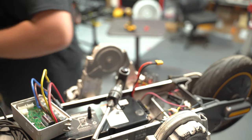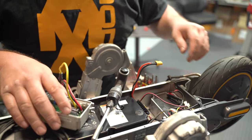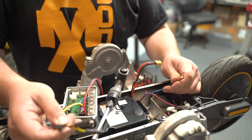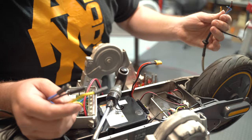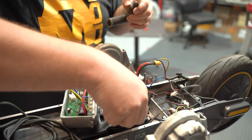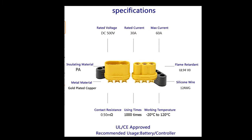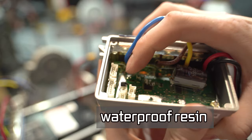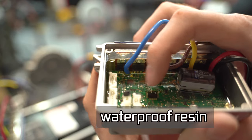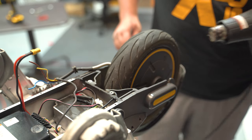This controller is done. We have a new controller here with new phase wires, and no phase wires on the motor, so we're going to upgrade these to MR60 connectors. My post-production conclusion is: if you're 200-plus pounds, have lots of hills, and are riding with a 48-volt external kit, it's probably worth upgrading to MR60 connectors — they can handle twice the amperage output. Also worth noting: that waterproof resin on the controller is probably a big reason why the Ninebot is so waterproof.